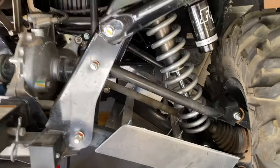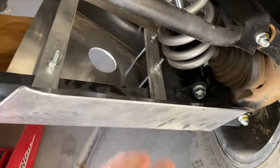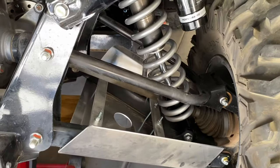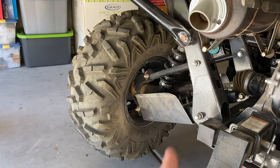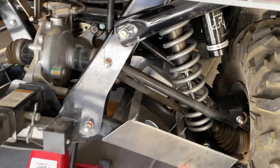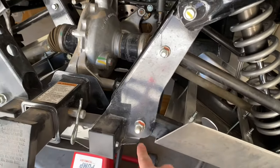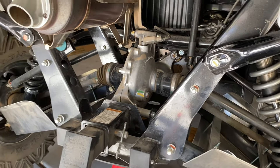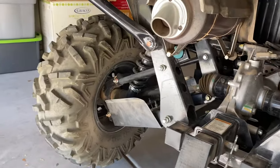Okay guys, we got the two fronts done and one of the back ones done. I didn't take off my tire or the A-arm guards, so it was pretty tight getting in there. It's a 17 millimeter to get in and out on the top and the bottom, but we got it done pretty quick. There is a little more flex you've got to do on the back to get it to line up because the A-arms are very tight. You could try to loosen them if you wanted, but we got it without doing that — so my recommendation is don't do the extra work.